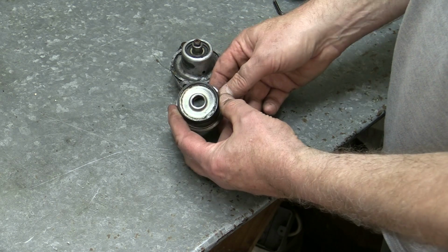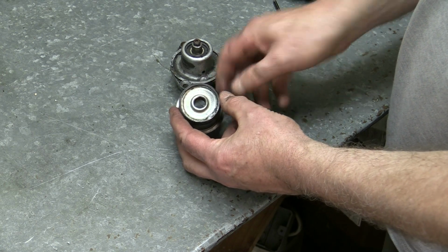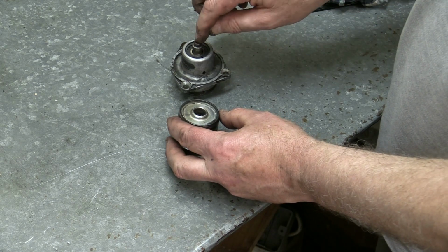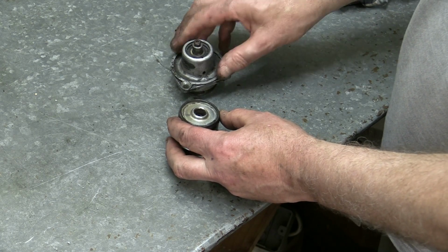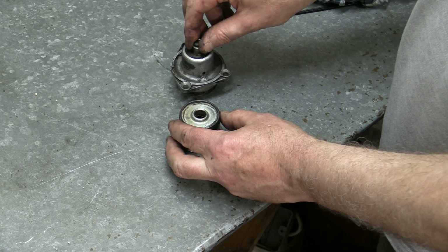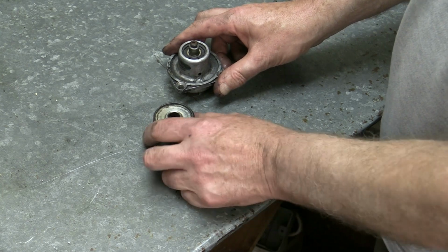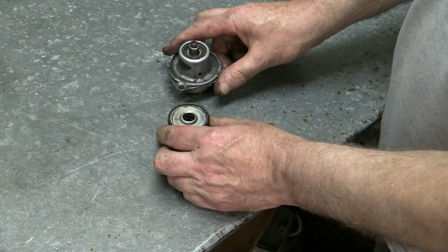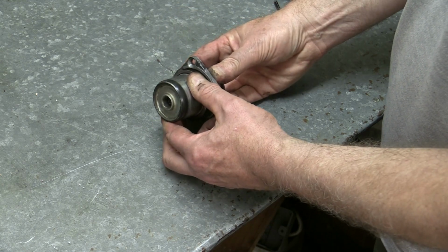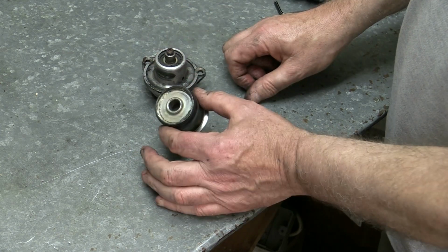I was a bit suspicious of the pulley after the original failure, so I used Loctite retaining compound on it, and I tapped the end of the new shaft I had made and put a bolt and a nice fat washer on the end to help retain it. It must have done something, because it lasted about 2,500 kilometres before it failed, and it is still a tight fit. It doesn't want to go on. So a bit of re-engineering is required.